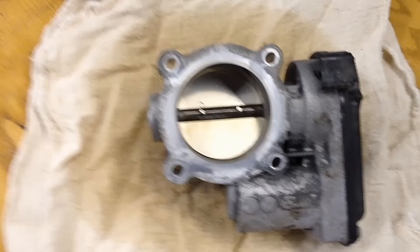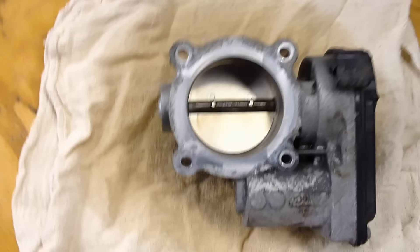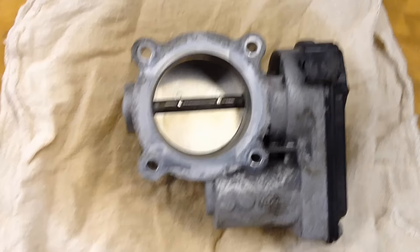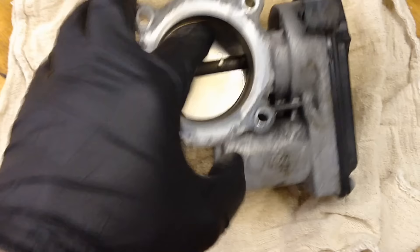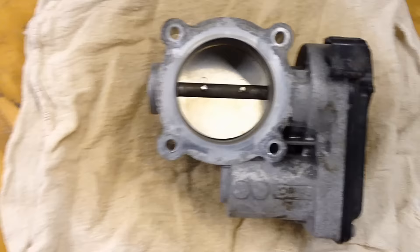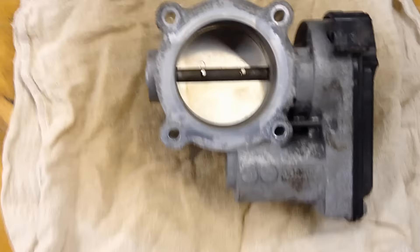Now while it's soaking, I'll tell you why I took it off the car. Electronic throttle bodies are different in that they have a motor and actual position sensors in there. If left connected while you're messing with this plate, you can actually ruin the motor — it's all still connected by the gear set. Leaving it energized while doing that is the primary cause of failure.